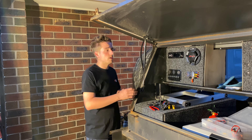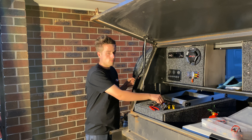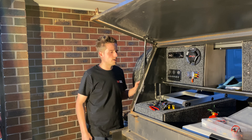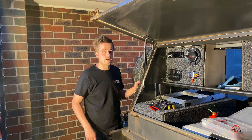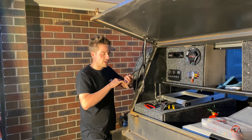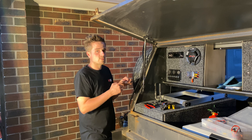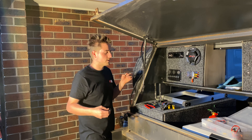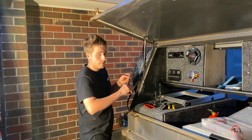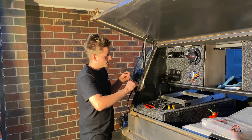I've got all that back together. I've got the cable run out the roof — I just need to run a little bit of silicone on the top to seal it, slide the tubing over, and put this little plug on. I'll cable tie that underneath the tent for now so it doesn't get water inside. You can see I've got a little bit of yellow light on — it is getting really dark here and quite late. With this plug I've got a little push-in terminal. They've got a little tab on the back that locks inside. I'm using the female side so the pins don't stick out at the top — that'll be the live side. So all I do with these is crimp them over a little bit on the copper and then crimp it over onto the insulation.